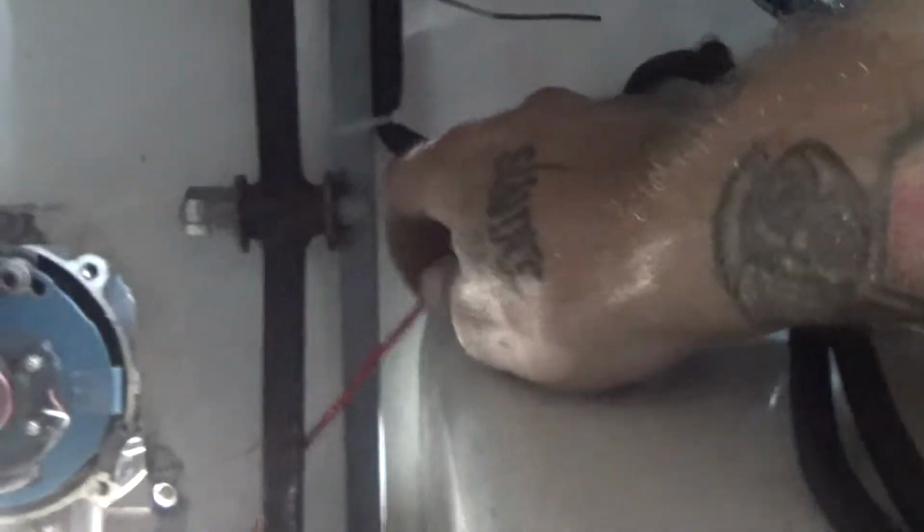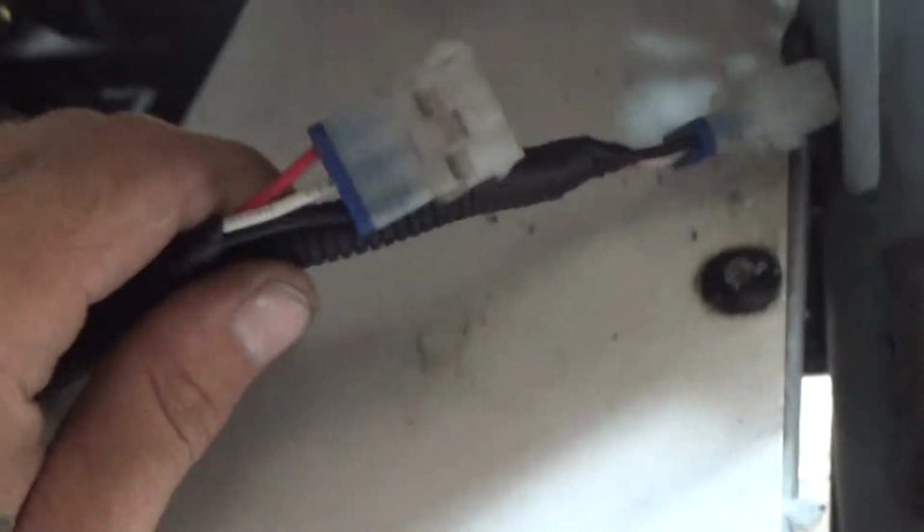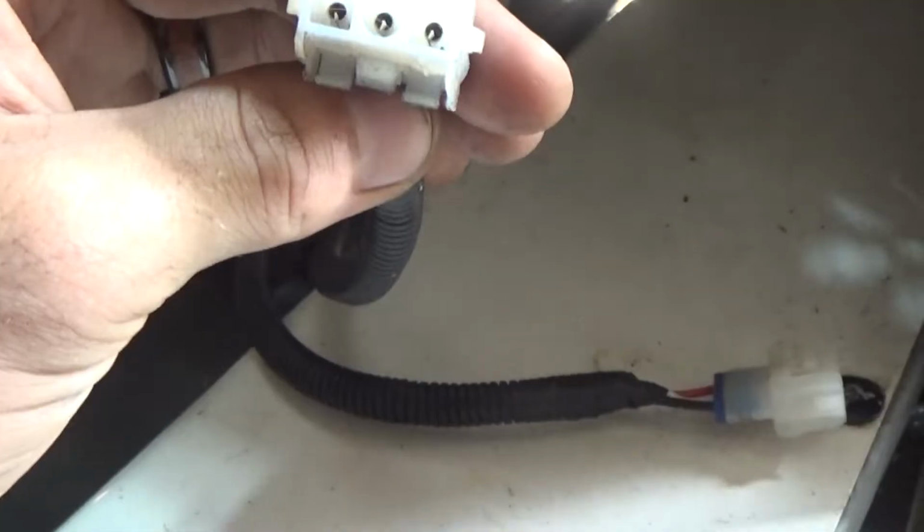What I've got as far as the wiring harness for the inside of the car, I've got everything tied in here. My existing harnesses for the headlights that I currently have installed on there and the additional headlights. The additional headlight harness runs here with that signal wire running down towards where I'm going to put my brake switch. I haven't figured that out yet, but I'm going to have to extend these headlight harnesses. One, I have to figure out how to get them through the firewall, so I'm probably going to use some kind of bullet connectors on those just so that they can actually be run through the firewall without a giant hole in there. I might be able to air saw a hole big enough that doesn't look terrible, that's kind of close to one of those other holes that are already there. I really might do that.